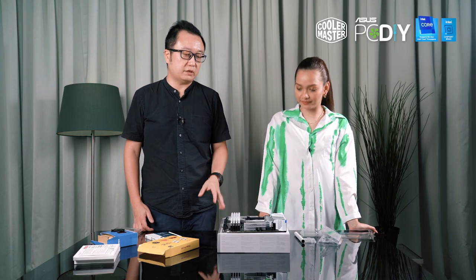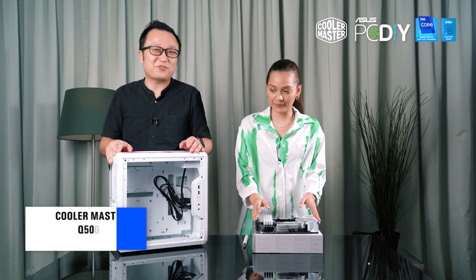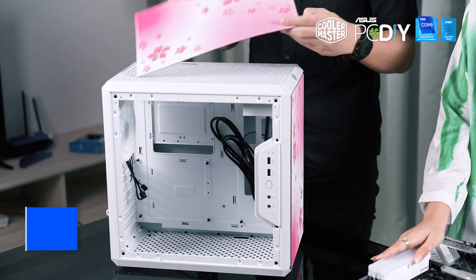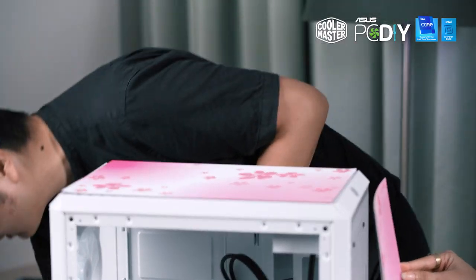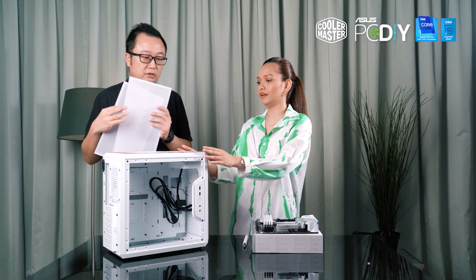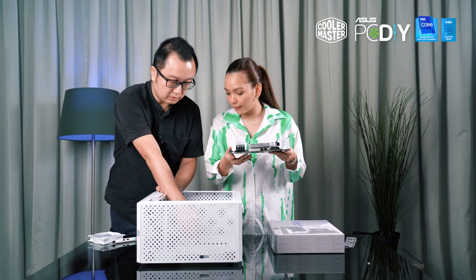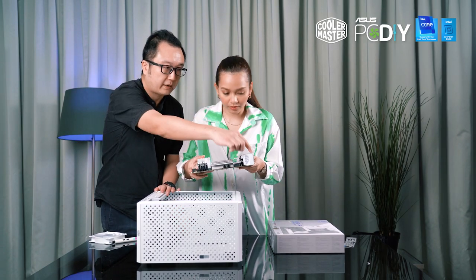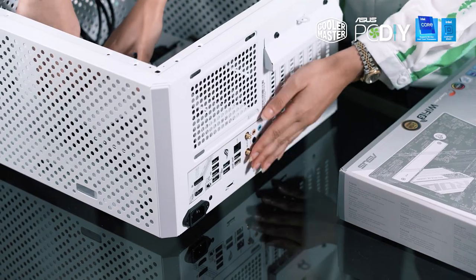Okay, cool. Done! So we have the CPU, storage, and RAM already installed on the motherboard. What's next? Alright, so next we are going to take the case and install the motherboard inside. Today we have the Cooler Master Q500L Sakura-themed case. The case comes with the Sakura dust filter — it's actually magnetic, front and top. This case also comes with a plain white filter, so if you don't want the Sakura, you can exchange it with the plain filter. You see all the standoffs here — align the back and then you install all the screws on the motherboard.